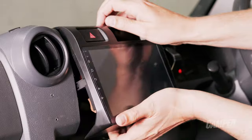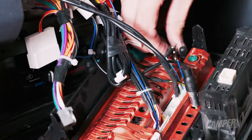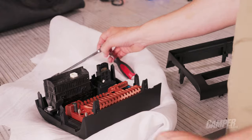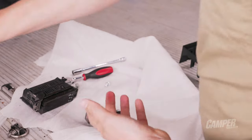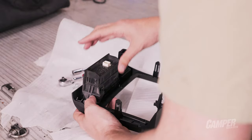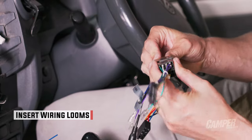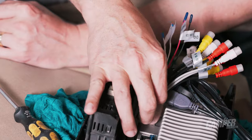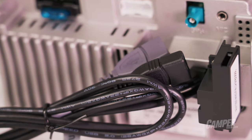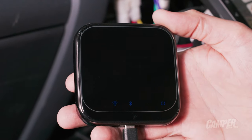The install is a 30 minute job. Pop the factory surround off, unplug the clock and hazard lights. If yours is a factory head unit you'll see four bolts that need to be taken out to remove it. You will probably need to take the side brackets off to mount the replacement head unit. As ours was a straight swap into the same fascia, we only had to bolt the unit into the fascia and plug it all in. Grab the patch looms and plug everything in. Here is where the AMH XD3 plugs in — in the back of the head unit you'll see a CarPlay/Android Auto USB plug. Plug in the module and you're ready to test it.